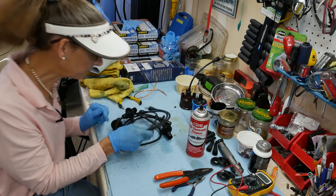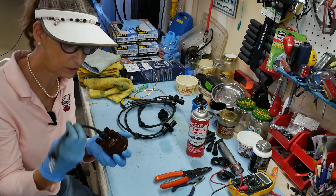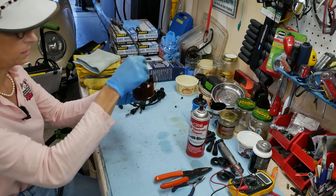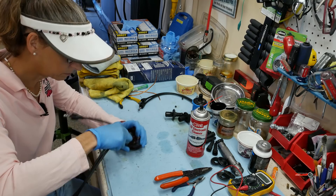That was a pretty massive fuss but we've got our wires all back — the original Berus with the new rubber gaskets and little spacers all ready to go. While we're here, why don't we go ahead and put them on top of the distributor cap to save one more step in the car. Cylinder number one is on the opposite side of our notch. One, two, three, four — and cylinder one is going to be the longest of the long wires.